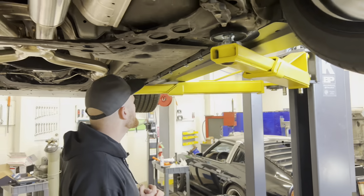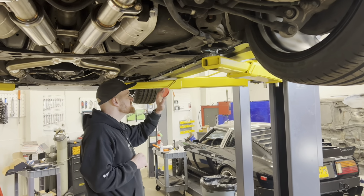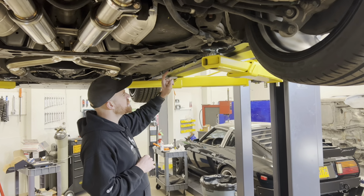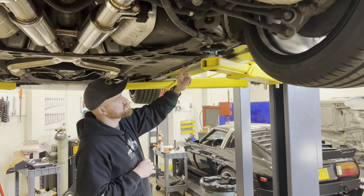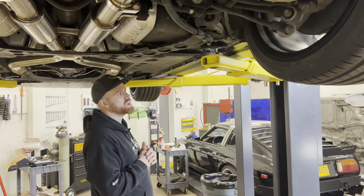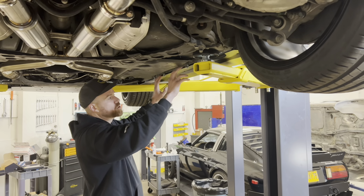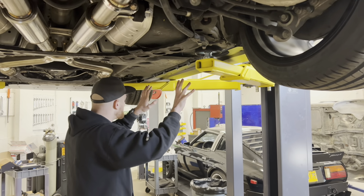So these 4 machine screws here, talking about the spacing, they all have a washer on the bottom, but then this forward one has 3 spacers, and then when I came back I have 4 washers, 2 spacers on the top, and then 3 washers, 2 spacers, 3 washers, 2 spacers. And what we found is that's a good fit to keep it nice and even and flat. Like I said, you might find that you want to adjust the pitch or the angle of how this is fitted up, so you can put more or less washers and spacers on there as you see fit.